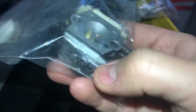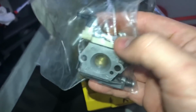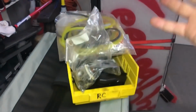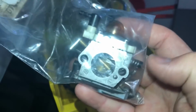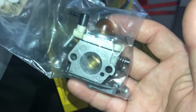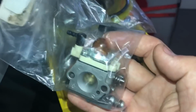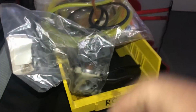Understand? And then if you want, you can change the spring. You can put a different spring with different tensions on it, so it'll keep dumping fuel on the top end. But do not do that on smaller engines or even some modified engines. If you have an oversized 32 full modified, or a 34 full modified, or like a high compression 30.5, and if you're drag racing only, then change the spring on it, so you're getting fuel still dumping on the top end.